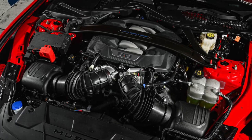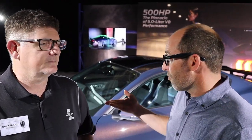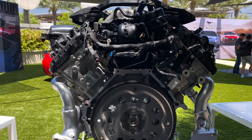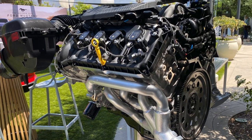Dark Horse Mustang, 500 horsepower out of 5 liters, which is cool all into itself. The big thing people are going to want to know is how does it compare to a Shelby GT350? So talk to me first about the engine. This is obviously our first naturally aspirated 500 horsepower 5-liter. From a 350, this is still a cross-plane crank car, not a flat-plane crank, so there's that difference. This is just the fourth generation Coyote — all of our best, all of our newest, everything that we want to move forward with. And smaller displacement than the GT350 — that was a 5.2, obviously. This is a 5-liter. The way we get that is all about airflow, really.